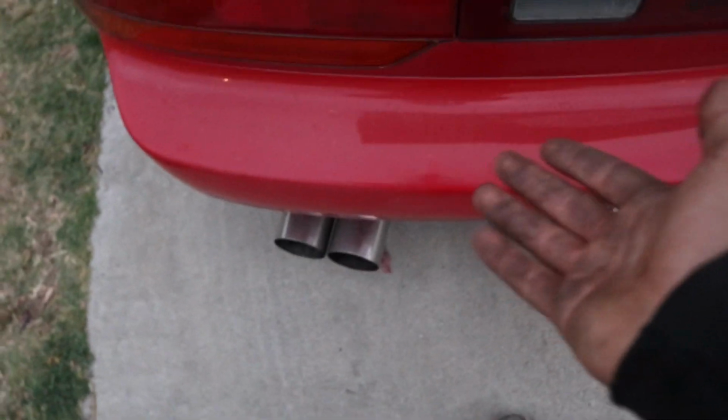If your 240 has never been messed with, or if your car has already had the bumper removed, 9 out of 10 times the bolts that hold the fascia on the crash bar are probably taken off and never put back on.